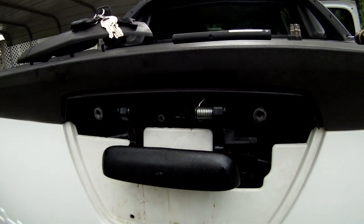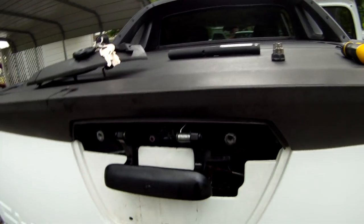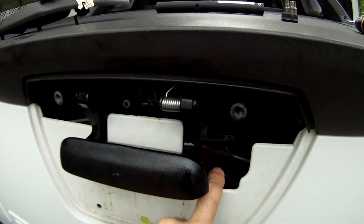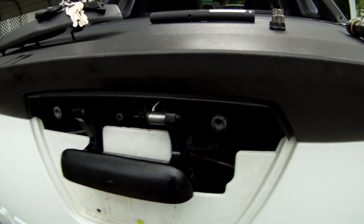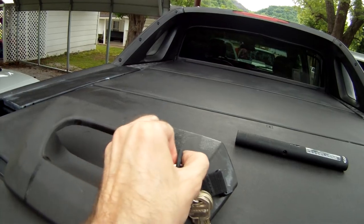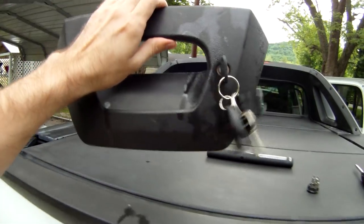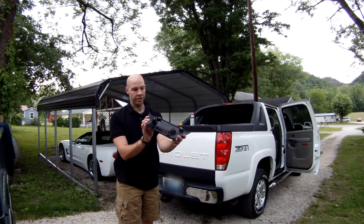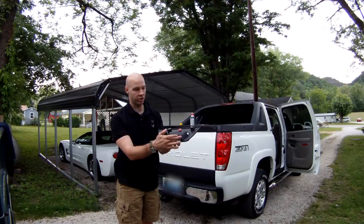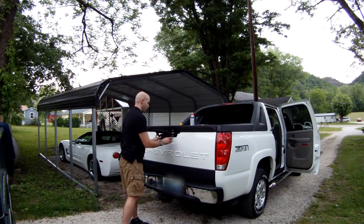The latching mechanism has now been realigned, cleaned, and lubricated. We're ready for final assembly. Make sure that the lock carrier is fully depressed — this keeps it in the unlocked position. Do the same with the lock cylinder by ensuring it is turned fully counterclockwise. Now reinstall the outer casing. Remember, the outer casing is held in place at the bottom by two plastic retainer clips, so to avoid any breakage, press straight forward as you reinsert.